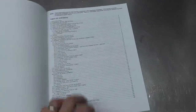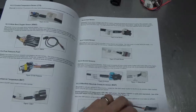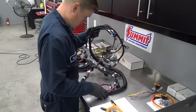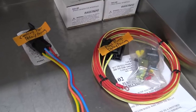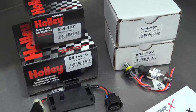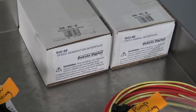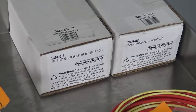This kit comes with an excellent manual that I'd read over a few times to get familiar with the pieces and parts and the overall installation process. I started by laying everything out, including the other systems that will need wiring, like the fuel pump and cooling fan. The Terminator X system will trigger and control them, but you need a good wiring setup with a dedicated relay for each. I'm also adding optional features like Holley's 3-bar map sensor, which you'll only need if you're running a turbo or supercharger. NA guys can use the Terminator X's built-in map sensor. I also picked up TAC and speedometer conversion boxes to make the Toyota stock gauges work, but after reading the documentation, I may not need these at all.